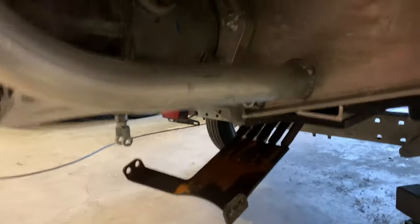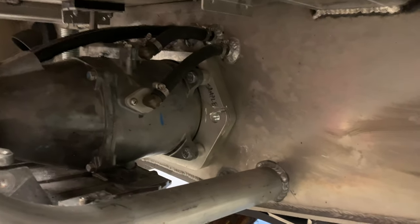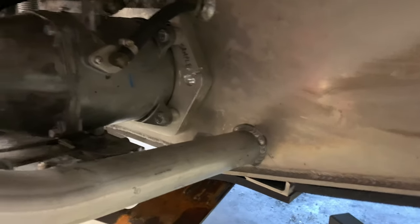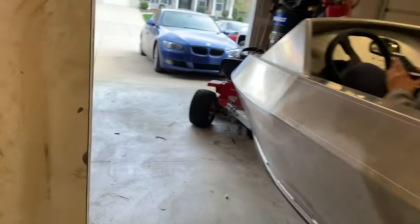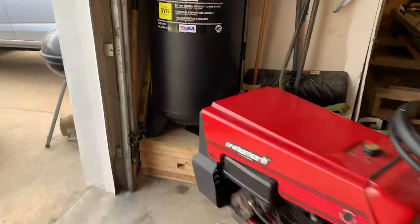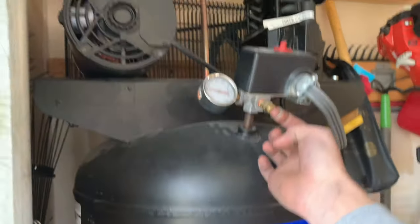I've been running my compressor consecutively for the last probably 30 minutes, and it's been going nonstop, and it's rated at 90 PSI at 4.5 standard cubic feet per minute. But I realized that I hadn't ever put a water separator on this thing, and I've never drained the water in it in the last like 3 months that I've used it, so I'm going to clean that now.